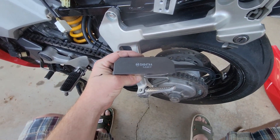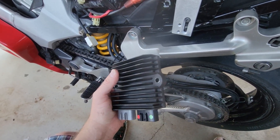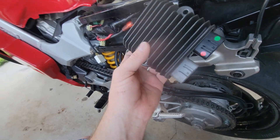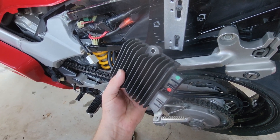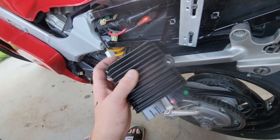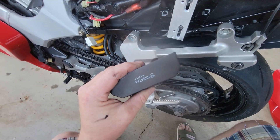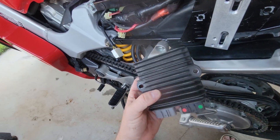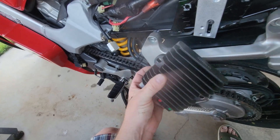We're going to be replacing this one with the SH847. The only application I've seen these go on is a Suzuki — the TL1000 and the V-Strom 1000. I got this from a vendor who pre-wires it for you: you tell him what bike you have, and it comes out to pretty much the same price as ordering a stock OEM one. The good thing about this unit is it's a series-type — it only puts out what it needs, so it runs a lot cooler than the OEM.